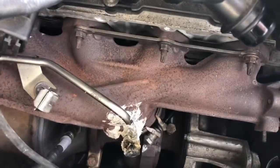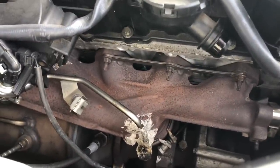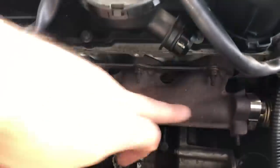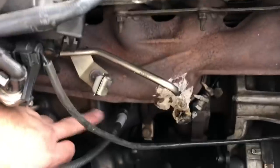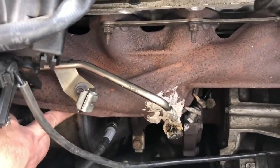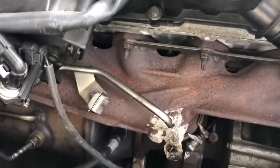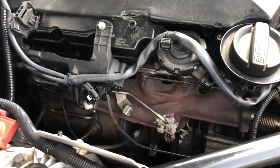I have got a whole new exhaust manifold to put on, but it is not quite as simple as it seems to just replace the manifold on this. Although I can put my finger on most of the manifold bolts on the top and these three under here, I've got a problem in this engine — the DPF sits so close just here underneath the exhaust manifold. Literally, I can't even get my finger in between them. So it's a bit of a pain in the ass, because when I fitted this manifold I had the whole head off the engine.